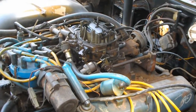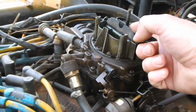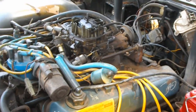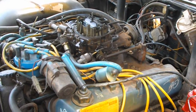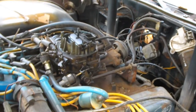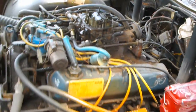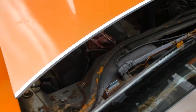It could stick in a variety of places — it could be stuck closed, sometimes it will be stuck open. It just depends on where the engine was sitting the last time it was run. This engine was probably sat for 10 years and I fixed this problem once, but I'm going to have to fix it again. The problem is that once she's running, that choke stays closed and it just floods the engine out.